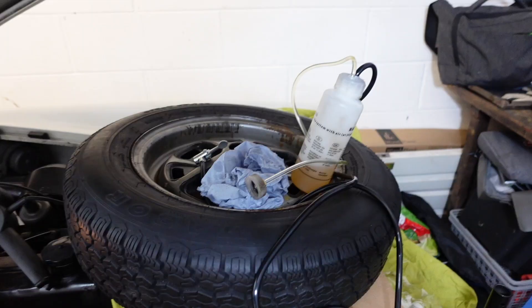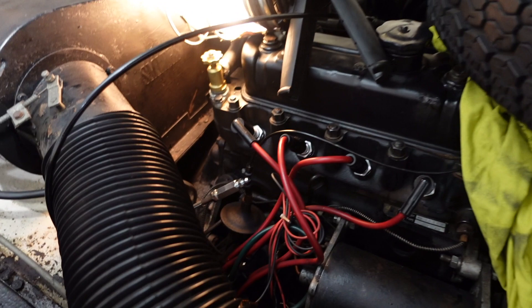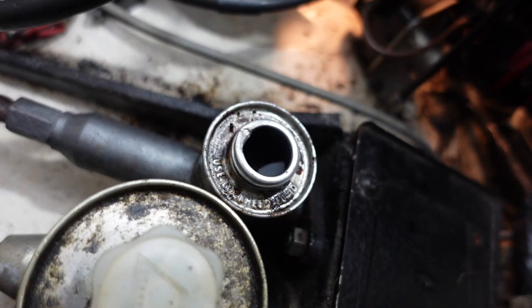Let's depressurize. The kit's removed, the nipple is tightened off down there, and the reservoir has fluid to the top. Now the thing is to get the cap back on, check all around for leaks, and then see if there's clutch pressure. That's everything put back together again. Next step is to test under the car and see if there's movement with the clutch slave push rod.